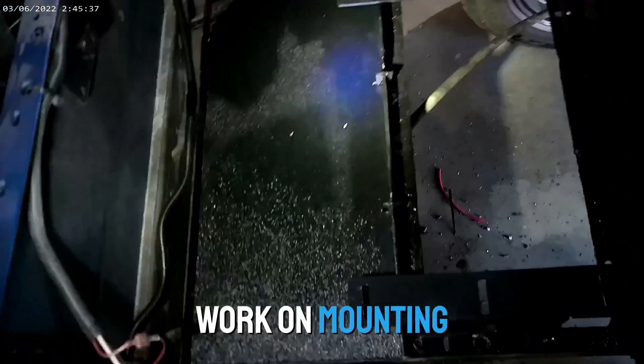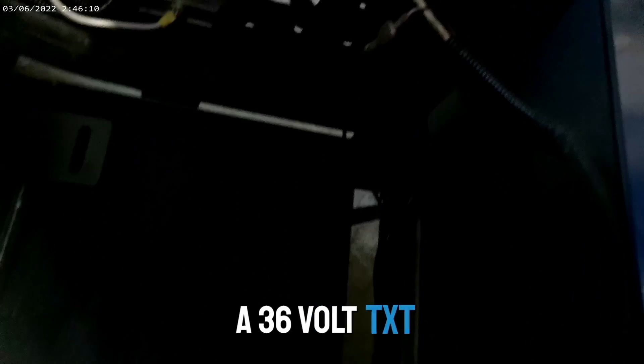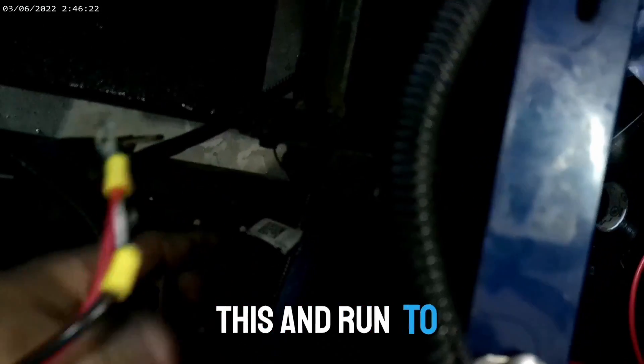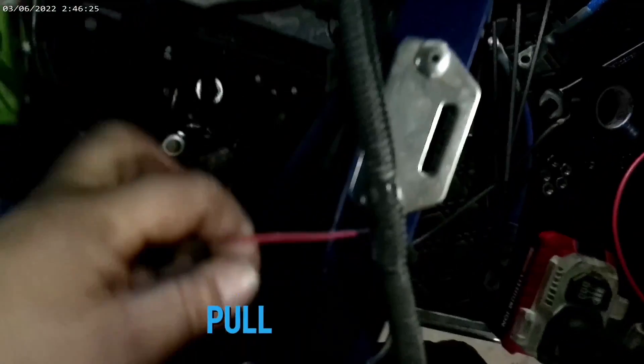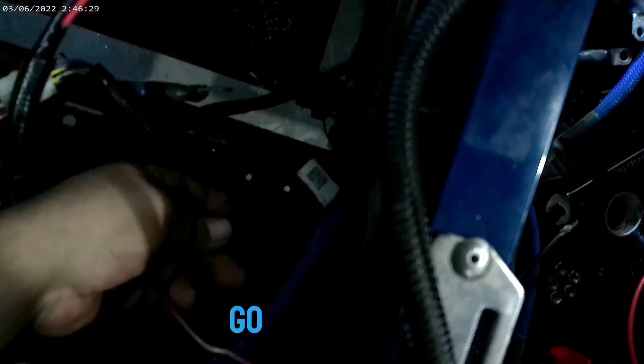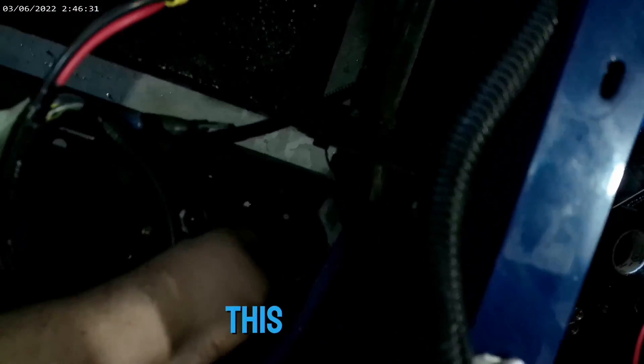When you're doing a 36-volt TXT, this is your reed switch wire coming off the charging port here. On the other side — the loom side — you need to take this and run it to your battery positive. So we're going to pull the charge port out, cut this wire, and extend it. This is going to go to battery positive. If you don't do that, this cart will not run.